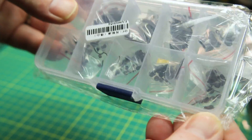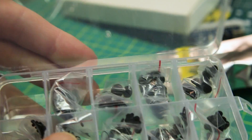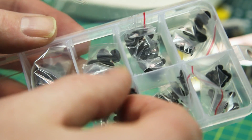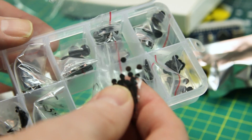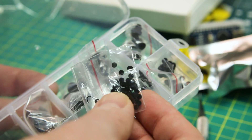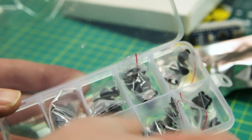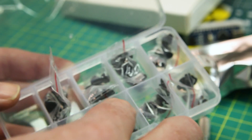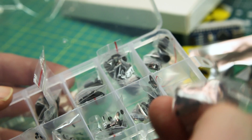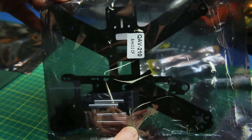Next up — I think I know what this is — a remote control repair kit, and it is! These are conductive pads you can stick on to replace the back side of buttons on remote controls that have gone defective. People have used graphite from a pencil or conductive paint, but that's ridiculously expensive. This little assortment is much cheaper and has pads for all kinds of different sizes. My Yamaha receiver has defective pads on two remote control buttons, so we're going to give this a go.